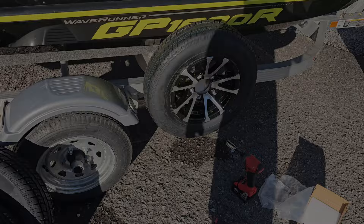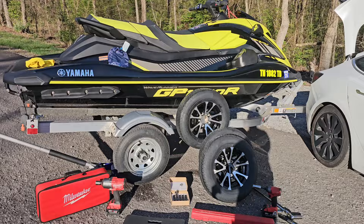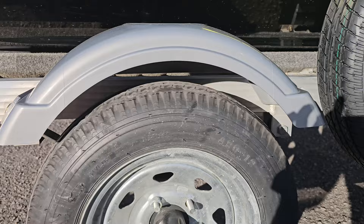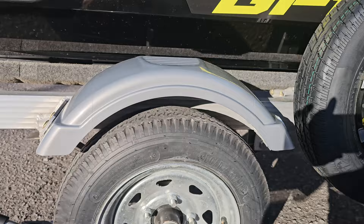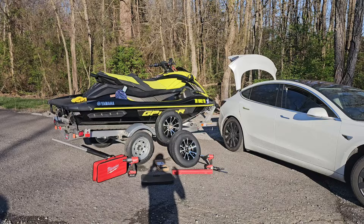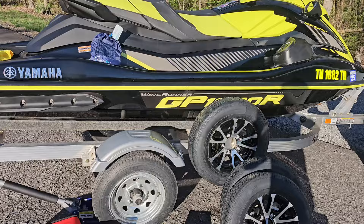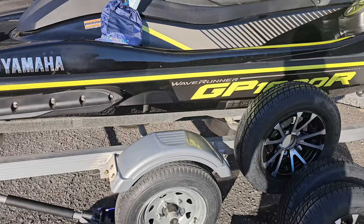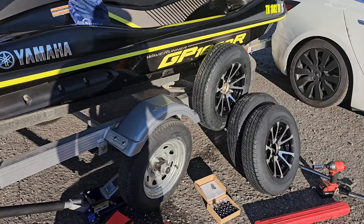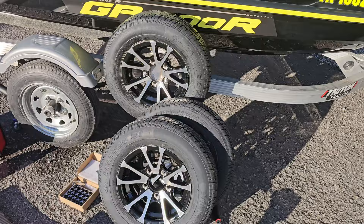In my last video, I was rotating the tires on this Tesla and showing how spinning the tire reveals if it's balanced or if the rim is bent. Right here I'm using my eyes to line up with the trailer and watch as I spin this. You can see there is a high spot and a low spot — that's what the bouncing is. Going down the road at about 30 to 40 miles an hour it is horrible, the trailer just hops. At 50 plus miles an hour the rhythm is different and you don't feel it as much, but it's still hopping. That is bias ply tires on this Triton trailer — about a $2,000 trailer — and they put the cheapest tires they can get on it. I'm putting some of the best: a radial tire.